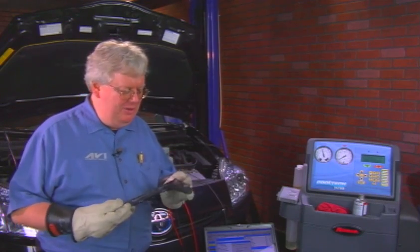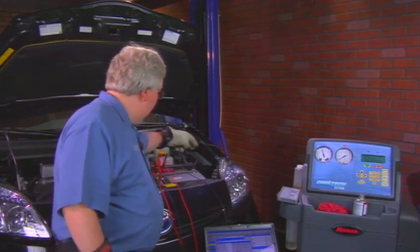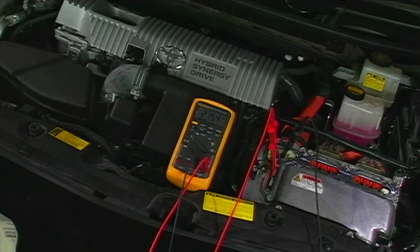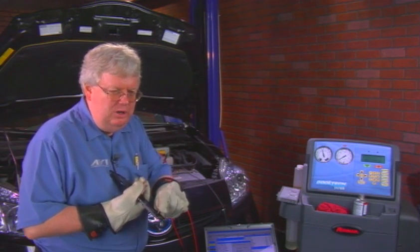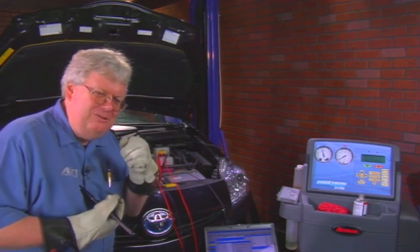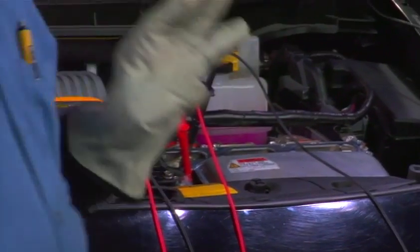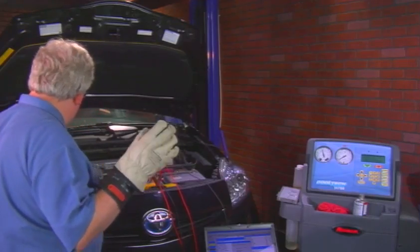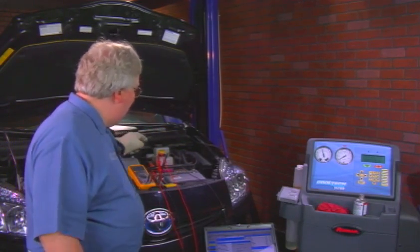On our voltage drop test, we've got the little inverter cover off of this downsized inverter on the generation 3, 2010 Prius removed, and the little shorting bar on the low voltage safety switch — that tells the computer 'hey, we've got something disconnected, better shut the hybrid high voltage system down' — we've got that removed and it's back in the hole so that we can work live. Remember, this is nothing to do for a technician who hasn't had sufficient hands-on hybrid training; this is pretty advanced stuff.